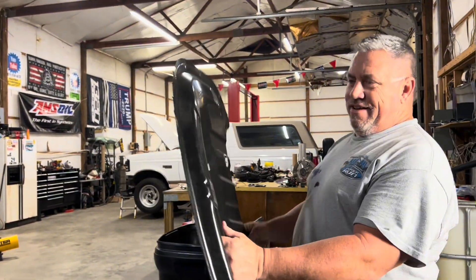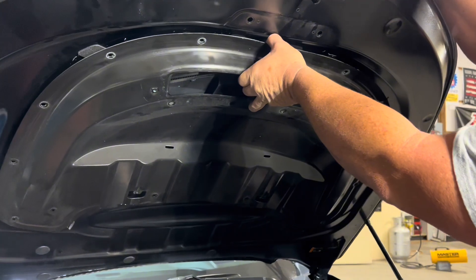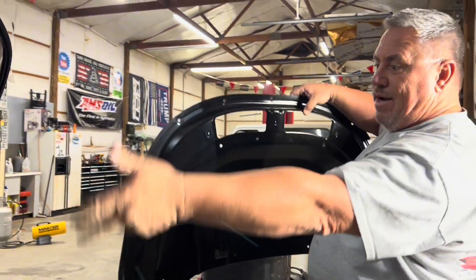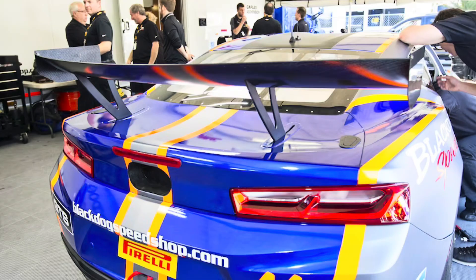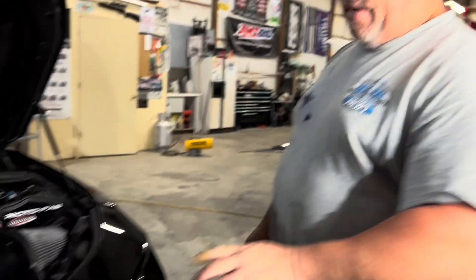This is the weather deflector. It originally laid in here like this, so the only airflow you could get out of the hood scoop was just through these two small ducts. Now, these make a big enough difference that they have a rain guard that keeps rainwater from getting into your car. I was looking online at the Camaro ZL1 1LE GT4.R car built by Pratt & Miller for racing teams, and while it has a much larger rear wing, it didn't have any real changes to the front end. The bumper was made out of carbon fiber versus plastic, it did not have the impact absorber — there are a few minor differences — but the architecture of the front end was almost identical, including the dive planes and the front splitter that come from the factory.